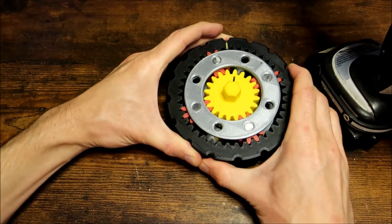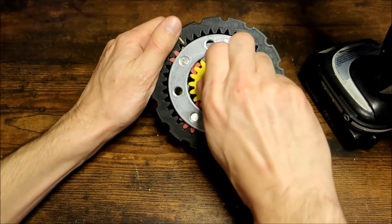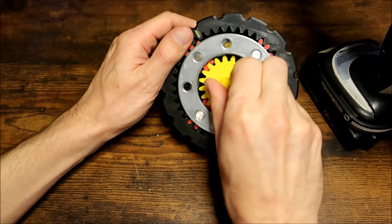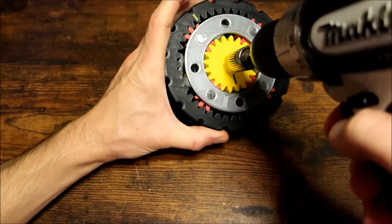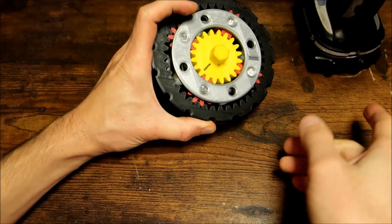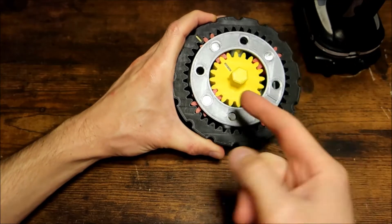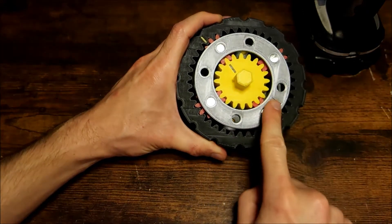Because I'm keeping the ring gear stationary, you'll have something like a clutch pack or a band that will physically lock and prevent the ring gear from moving. Whenever that happens, this could be something like an input shaft driving the sun gear, and the carrier could be attached to something like your output shaft. Your output shaft is going to be connected to the drive wheels. So whenever I drive the sun gear and hold the ring gear, what I was telling you is — if you look at the rotational speed of the sun gear compared to the carrier — you'll notice it's rotating several times for every one rotation of the carrier assembly. This is what's known as an under-drive gear ratio.